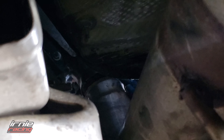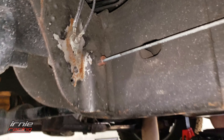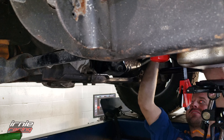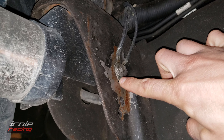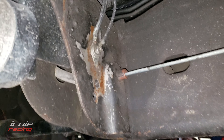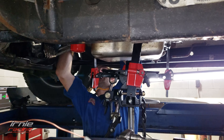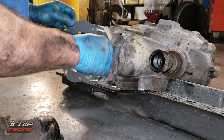I'd like to mention a tip: this is the ground below the driver's door. When I first put my vehicle into four-low, I'd get a 'service four-wheel drive' code and sometimes it wouldn't switch to low. I found a YouTube video where a guy explained that a fix at the dealership is just cleaning the ground. I cleaned and ground down this whole area — it was forming rust — and it absolutely fixed that service fault. Now it goes into four-low and back to four-high with no issues. Good little tip along the way.